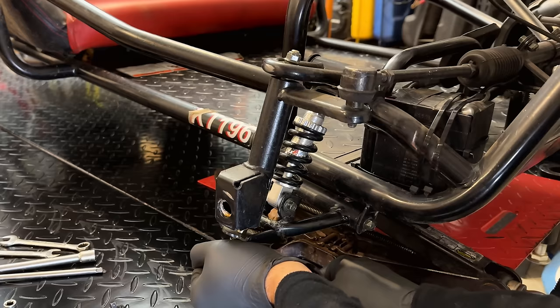These are both clones of a Honda GX200, and likely the crankshafts are interchangeable. I won't know that for sure though until I get them out and measure them up. So I think that's what I'm gonna do. So let's start with the old engine. We'll just get the oil out of it, open it up, get this crankshaft out, and then we'll do the same on this one. And with any luck, we can swap the cranks and be in business.